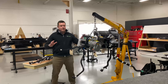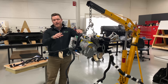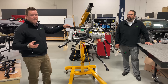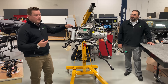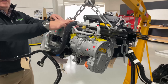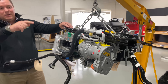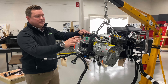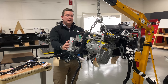The first thing to notice here is location, location, location. Many of the components for the Tesla Model Y are very close together. Ben is going to bring the corresponding pieces and parts from the Mach-E, put them on the table, and compare and contrast the hoses and lines that run between them. Right here is the R1234YF pump, hanging off this cross-car bracket from the Tesla Model Y. Tesla chose a steel bracket; Ford chose aluminum. Tesla focused heavily on getting everything as close together as possible.